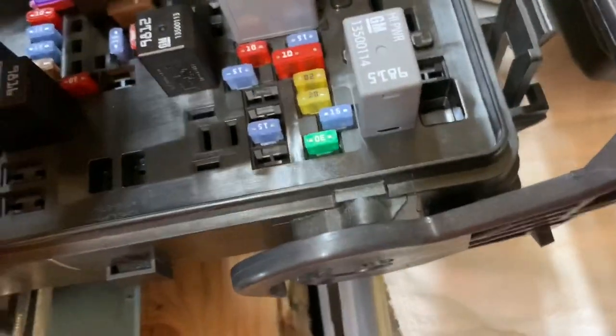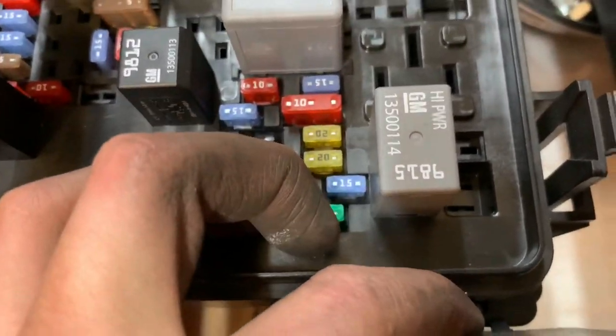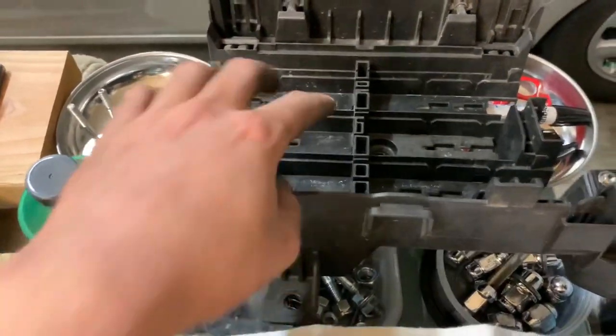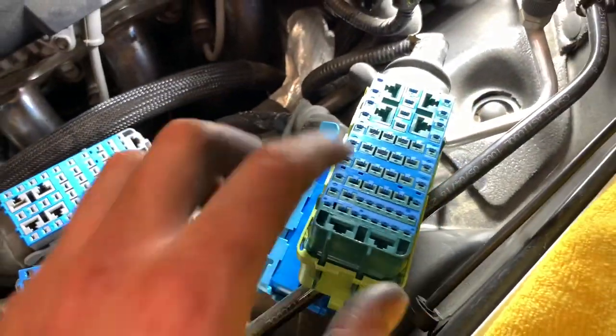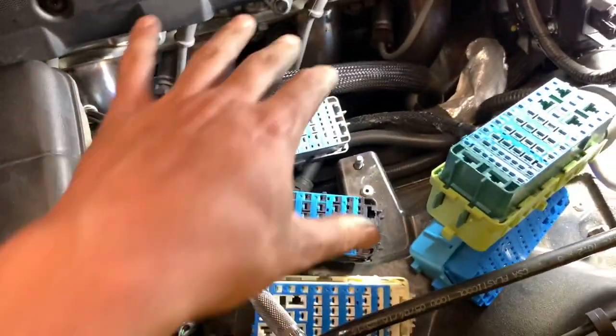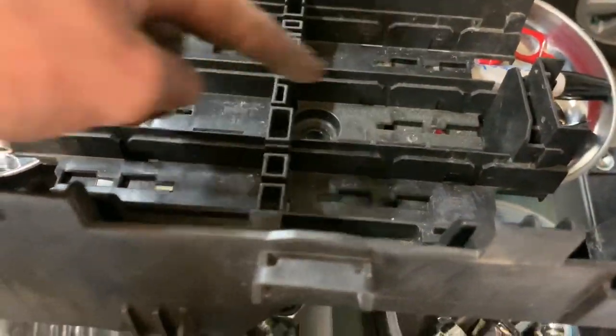The handles just pull up and it removes the fuse box — it's down like this and you can't move it. So you take a screwdriver in here and basically just pry these little pieces back, then the handles lift up and the whole thing just comes right out. Once you get to the bottom tray, the one screw in the middle — take that out. To take the little computer modules out right here, it stays together in one piece. You basically just pry it in the middle and the whole thing slides out each direction — these three go this way, these two go that way. Just put your screwdriver in these cracks, push it each direction, and the whole thing comes out and you've got all this free space.